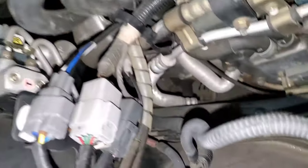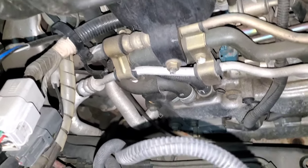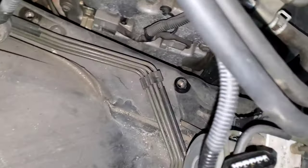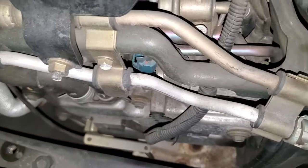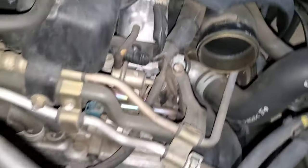Just doing an inspection of everything because this isn't always off and it's harder to see everything, but it looks good down here for the most part. Looks like my bottom camshaft seals are sweating a bit - those will be replaced with the timing belt kit, which I will have to do probably before winter. Everything else looks pretty good, it's very clean down here, that's what I like to see.